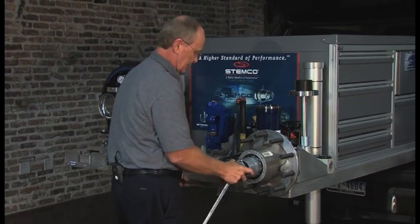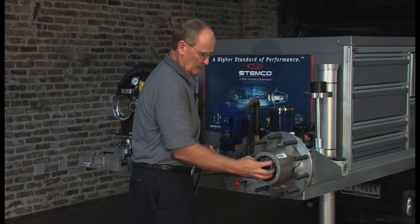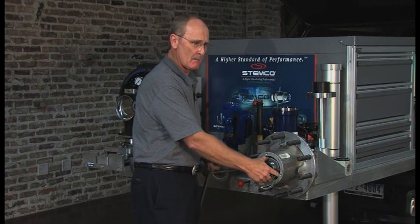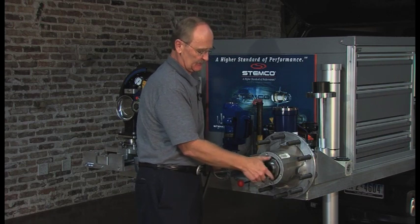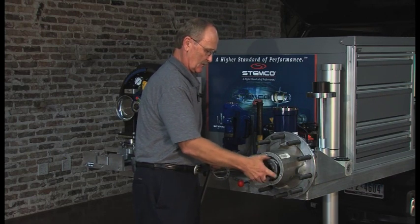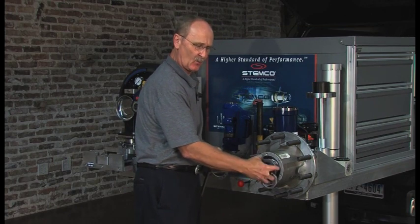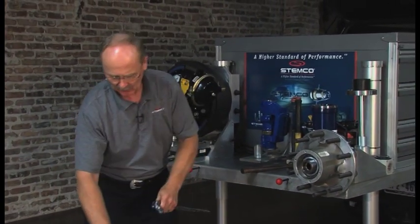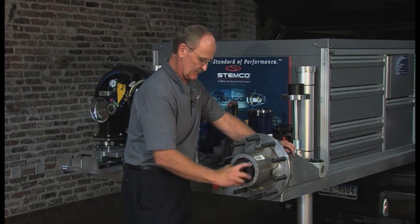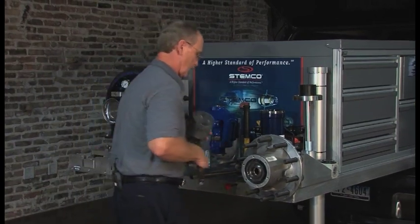Do not use impacts. Bendable stars — replace them. If your bearing adjustment is done correctly for a standard bearing adjustment, you should be able to take the inner nut off with your bare hands. The nice thing about the pro-torque nut is it doesn't matter if you're working on a steer, a drive, or a trailer — the bearing adjustment is always the same; the only difference is the back-off. Hand-tighten the pro-torque nut, then take your breaker bar and draw it up. Always start in a relaxed state, so back it off first.